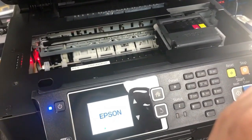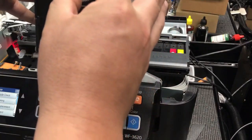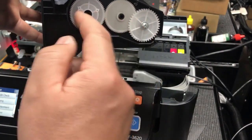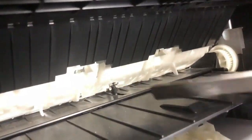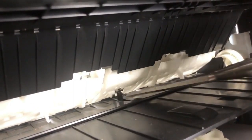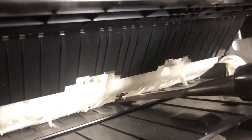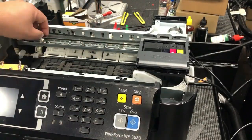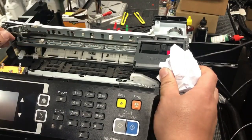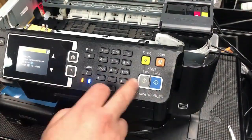The customer has a problem, which I showed in the earlier video, about a printer that can load half a page then get stuck. I'm going to put a link to the video above. Basically, the printer rolls up the paper from the duplexer and the paper touches the ejection lever and pushes the lever away. The ejection sensor will think there's a piece of paper and the printer can't start printing. However, my customer already checked the lever according to the last video, but the lever was intact — no obstruction at all. He's still experiencing the paper jam.